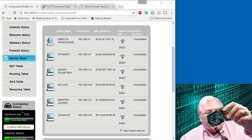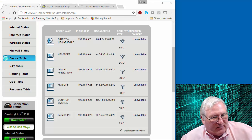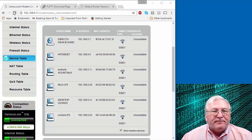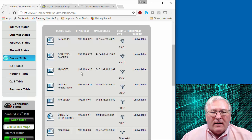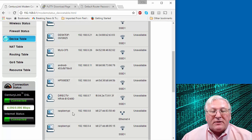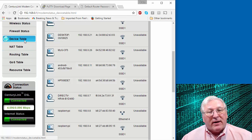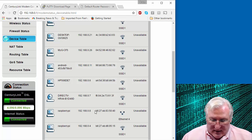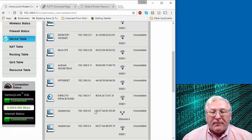It's been about a minute. I'm going to set this down and get back to my keyboard. It should be booted now. I'm going to refresh this page on the router — and you can see the Raspberry Pi is showing now. This is a way to get those IP numbers. Because I'm demonstrating both Ethernet and wireless, I can see two new numbers: .04 is the wireless connection, and .08 is the Ethernet connection. Now I have both noted, and that's going to allow us to connect with the terminal.